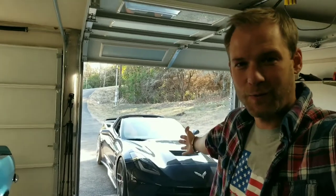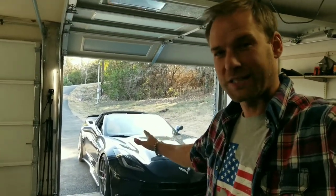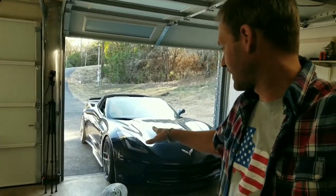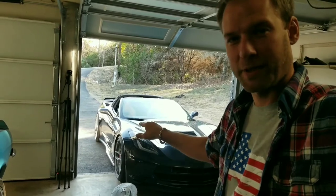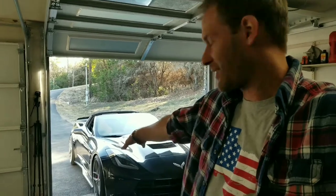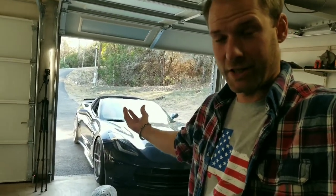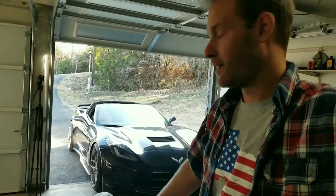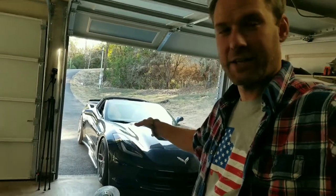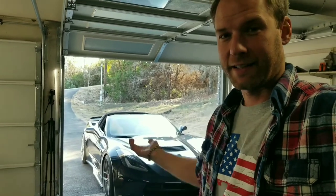Okay, here we are, and we're ready to get down to work. This is about as good of a workspace as I could muster up. Being with the car so low, I had to kind of use the little bump up on the garage entrance, coupled with a 2x4, so I can get a jack underneath this thing and the factory body mount area or lift point. And just do one side at a time. So we're going to start here on the passenger side, which is the actual warped side, and get that pulled off.